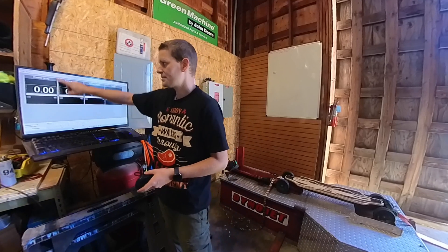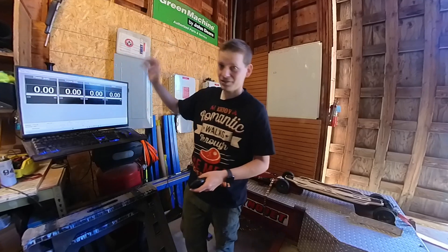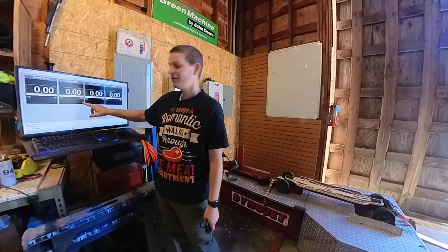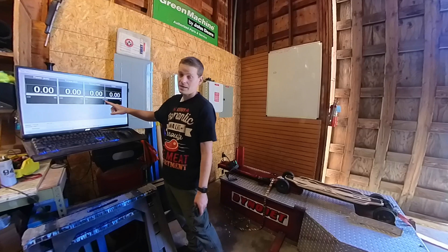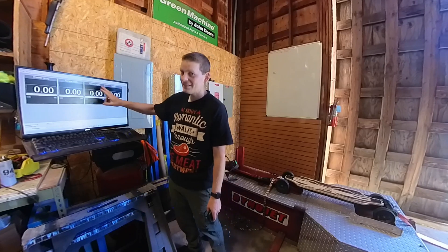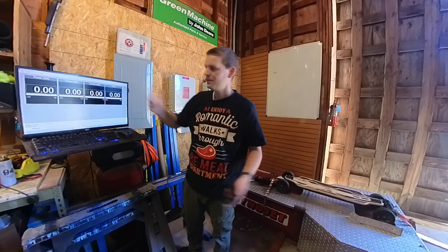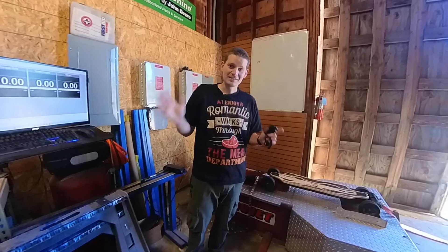On screen here is the max power — this is what you want to watch, in kilowatts. If we actually got 7,000 watts we would see 7.00 right here. We can also measure foot-pounds of torque right here — I bet it's going to do pretty well on torque. The speed in miles per hour will show up here, though it's not a realistic speed since there's no aerodynamic drag and no rider weight, but it does give us the max theoretical speed. And this other reading is just the RPM of the drum itself.